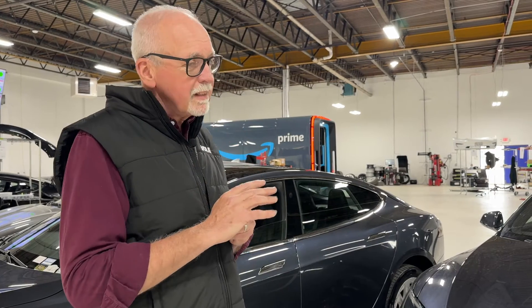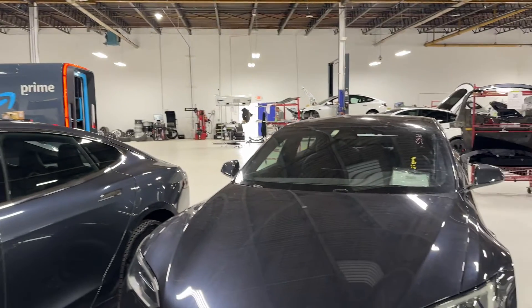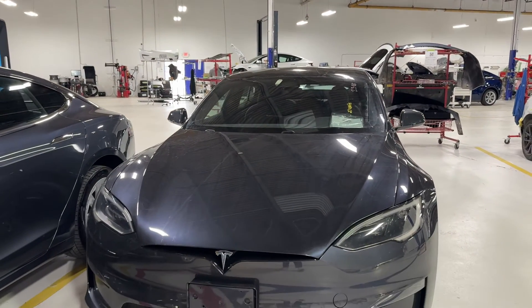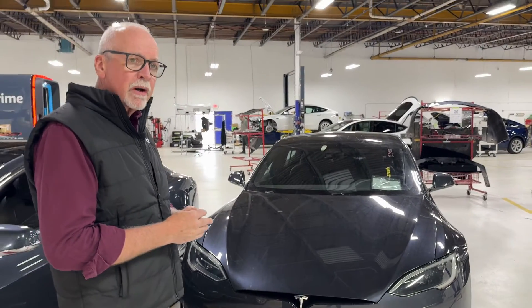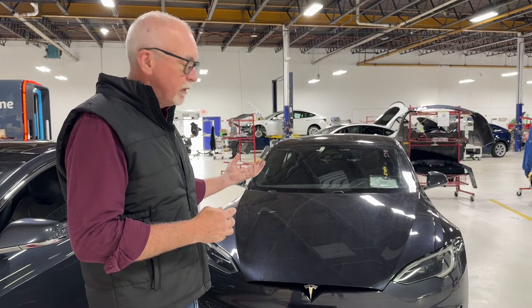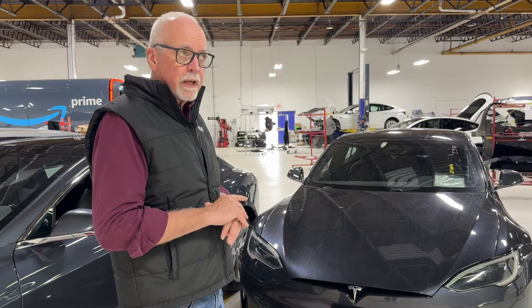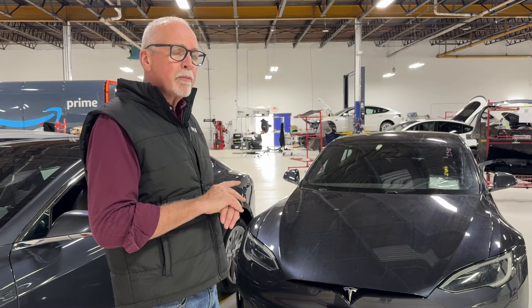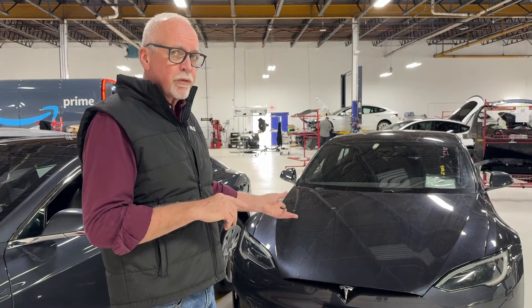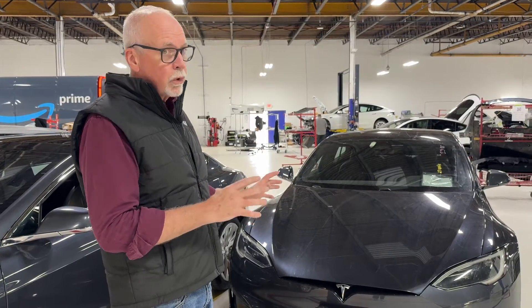Some newer colors are three-stage colors and some are four. Technically, some could be five. So Stealth gray — is this a two-stage, three-stage, four-stage, or five-stage? I don't know the answer, but in the aftermarket, the manufacturers have a two-stage version of this color available. It's probably pretty close right now, but I'd bet anything we'll see a three-stage solution because most likely it's a three or even four.